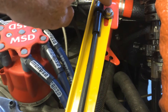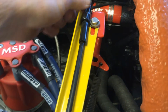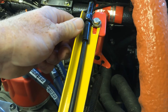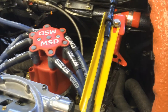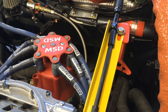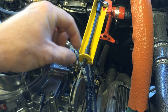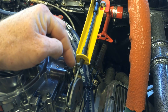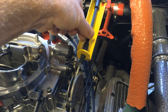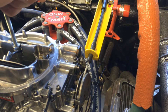If I was going to make an adjustment on this, all I would do is loosen the bolt right here and slide my whole assembly up a little, which would pull the throttle open, or slide it down to give a little bit more slack. That's all there is involved in it. Some linkage adjustments are done with a jam nut on the backside and an adjustment on the front, so instead of just being a guide it would have a nut and a threaded sleeve. You would loosen up the nuts, pull your cable back, and adjust your jam nut up to it — that's how you make your adjustments to your throttle.